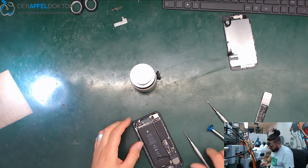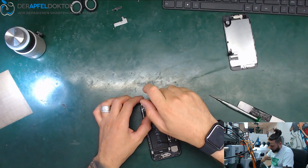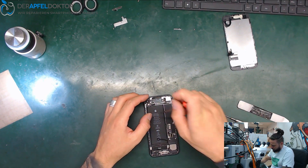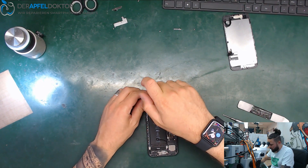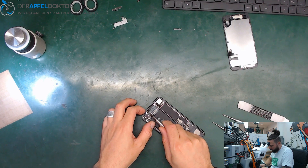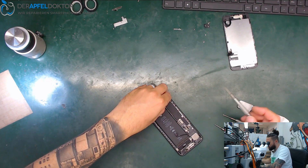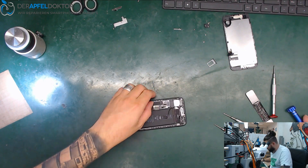Yesterday I showed you a data rescue of an iPhone 7 which was salt water damaged, laying at the ground of the sea for about two hours, and it was just a little VDD main short. We had to use our eyes, our head, and see where the corrosion is, clean the corrosion at the different points on the board, then checked by terminal, saw the short, removed it, and we could save all the important data. I phoned the customer yesterday evening and told him the backup is completed — he was really happy.